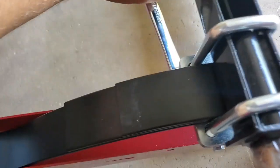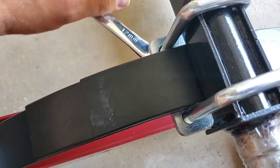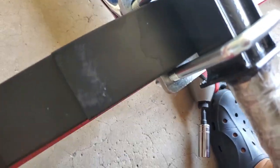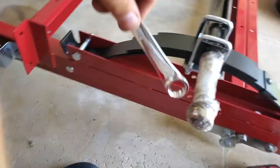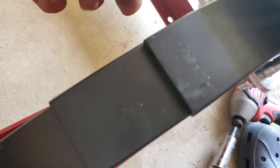Always check by hand — take the 17-millimeter ratchet and check these bolts under the axle by hand, because the axle cannot be moving. You're going to have a wheel attached that's going to be on the highway, so make sure your axle is very securely fastened.